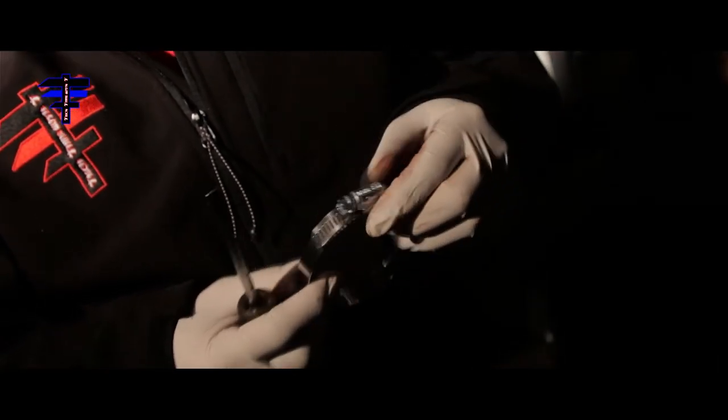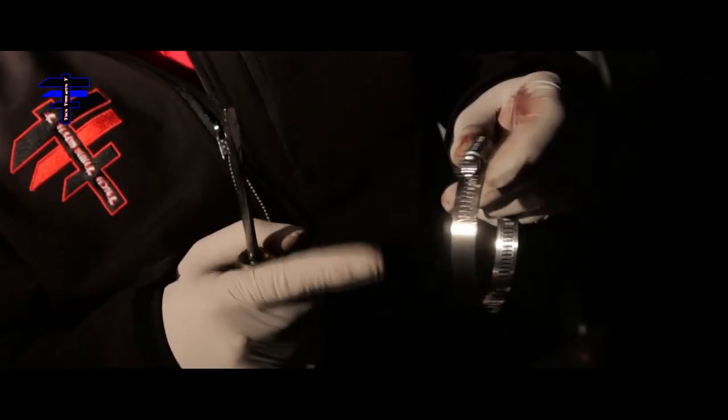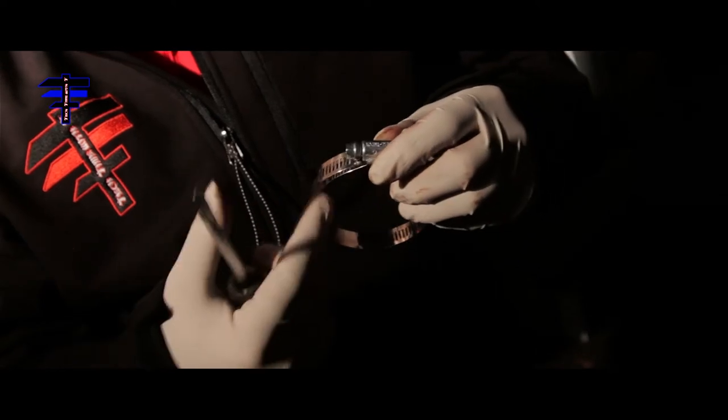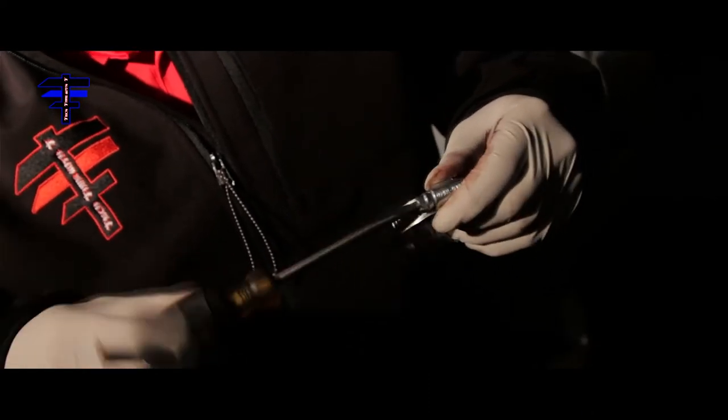Basically we're not gonna look at the small ring right now. What you want to do is turn it counterclockwise on the screw so it comes out, and that way you can wrap the heat shield onto the exhaust pipe. Just keep going counterclockwise on the screw all the way out — use a flathead screwdriver.